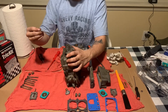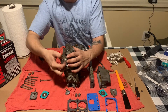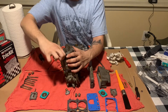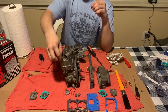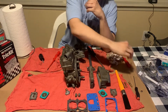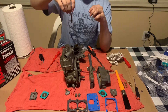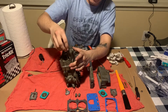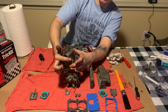These big screws here along with these little gaskets go right there, and these giant long screws go in that hole like so. Now what Wildman is doing off camera is taking these old screws — because the Rebo kit does not give us any new ones — and using the Dremel and wire wheel to clean up these threads to make sure we get a good seating on the threads inside this carburetor. That way it makes it just that little bit easier to thread in, and I can do it with one finger.